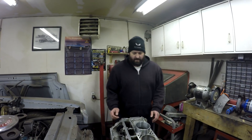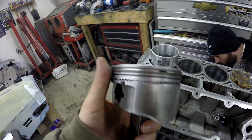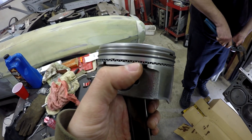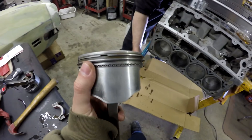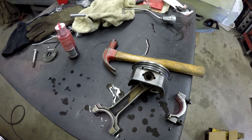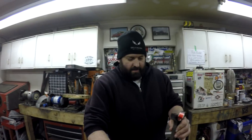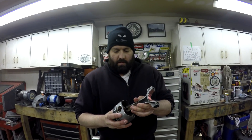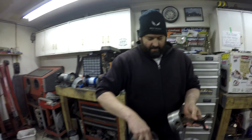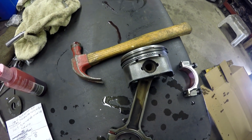The ring package will be pretty similar on any internal combustion engine. On this piston there are two compression rings and an oil ring. The oil ring is made up of a center ring and two retaining rings on the top and bottom. The two top compression rings are just a single ring each. With boosted applications, ring gap is something you want to pay attention to — if you leave it too tight, the ring will actually butt together and bad things will happen, like taking the top off a piston. If you file them too large you'll have blow-by, but that's preferable to catastrophic failure.